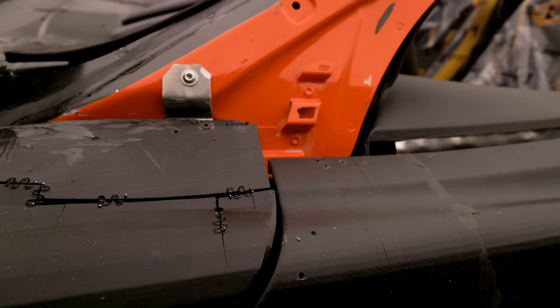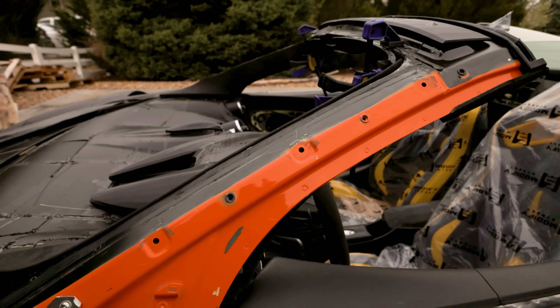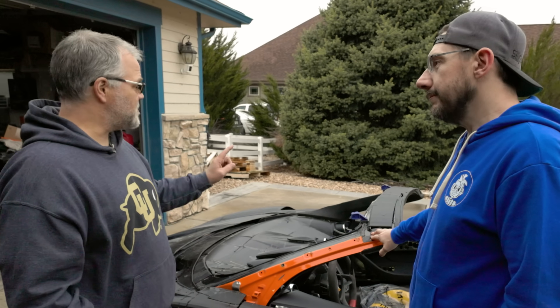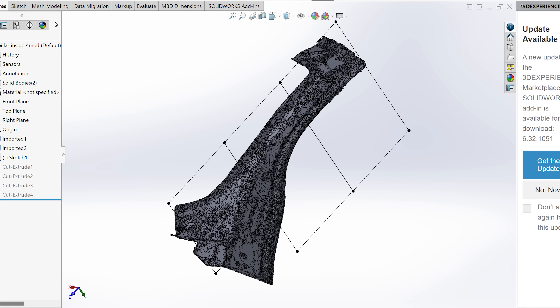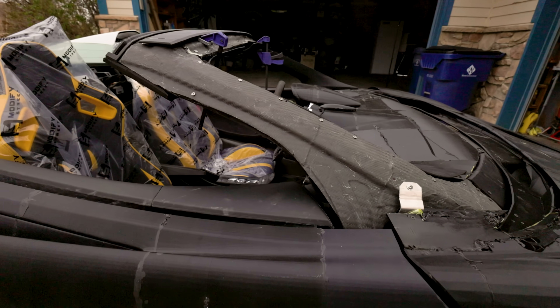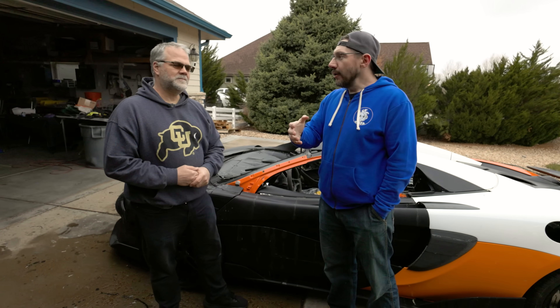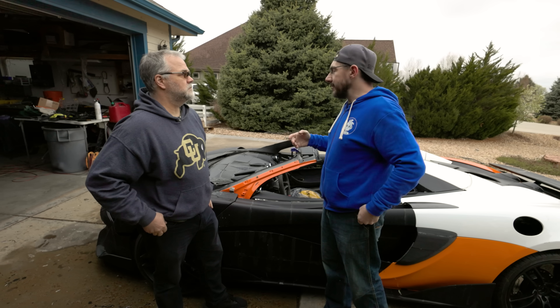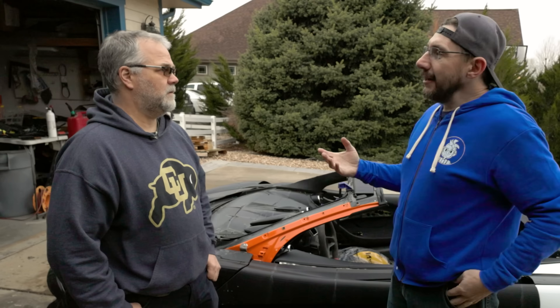Let me give you a really good example of why this is important. Look at this A-pillar — this is an aluminum A-pillar from the car, glued to the tub. It's a McLaren A-pillar. I scanned it because the A-pillar on the other side was destroyed. I mirrored it in CAD, 3D printed it, skinned it in carbon fiber, and now I have a really strong carbon fiber A-pillar on the other side. How easy was it to mount in place? It was right on the money.